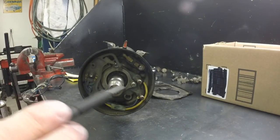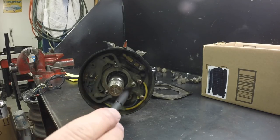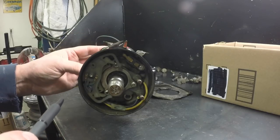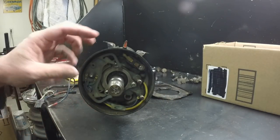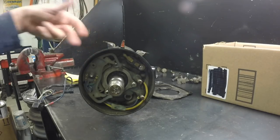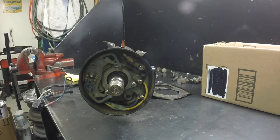The shop manual shows nothing about the disassembly of these steering columns whatsoever — it shows an exploded view. It looks like I need to take these screws out, this comes off, then I can take this out and start taking some of the turn signal and wiring stuff out of the column. First I've got to get these connectors off, then I can start taking snap rings and screws and get this collar off. This collar I'll just clean up in my bead blast cabinet and repaint, and this collar I'm replacing. I can paint this chrome piece when the thing's apart, and I'll paint the column. I might just bolt it back in the car and let it hang down when I go to put the dash in.